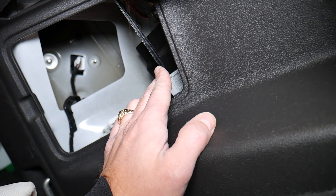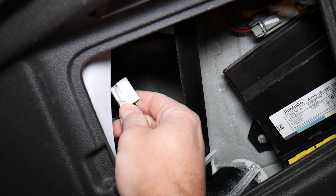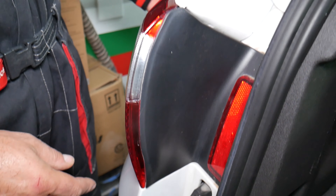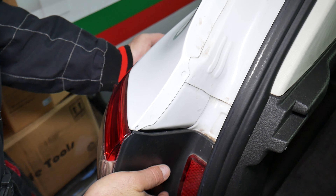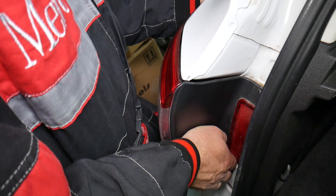You'll see that the thread is actually a little bit stuck to the metal, so you need to lift the tail light up a little bit. We're going to disconnect the cable here by pressing inside — right here you push it for the stem to release the pressure of the clip, you press down and pull it out. Now grab the light — you may have clips here and there. There's nothing else holding it, but it may be stuck, so wiggle it a little bit. Grab with two hands, you need to come straight back — don't pry with anything because you will break it.